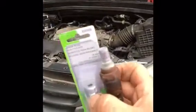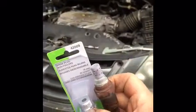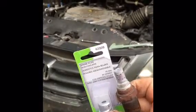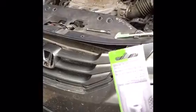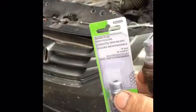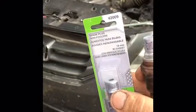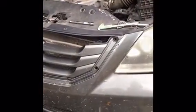You want the little hole to still remain in one of them so that whenever you install it into the vehicle, very little of the exhaust gases can get in there. The theory is that it should level out the reading and everything will be fine from that point on. The code should clear. We're not sure whether that's going to happen — this is all trial basis, just to see if it will work on this vehicle.